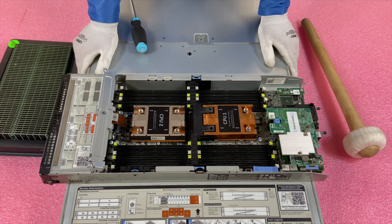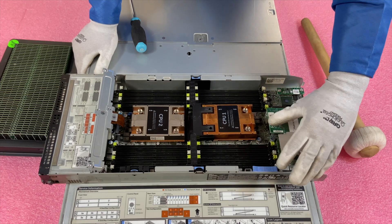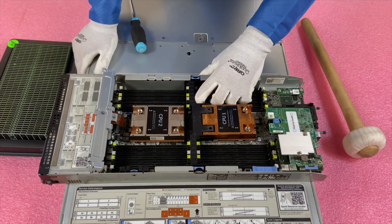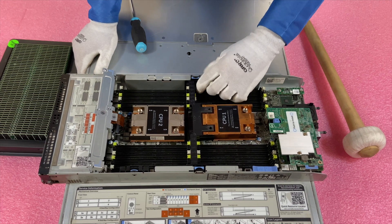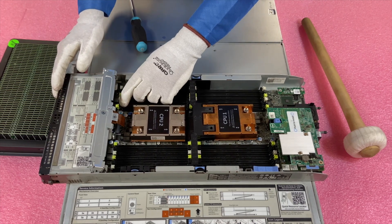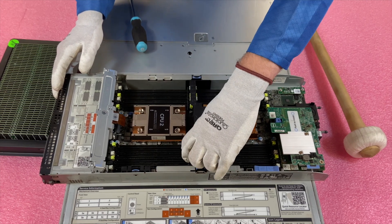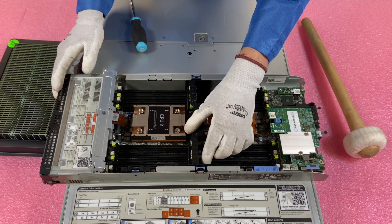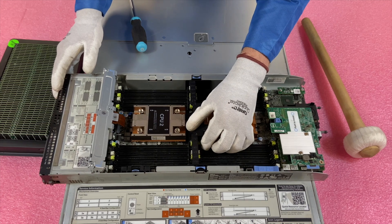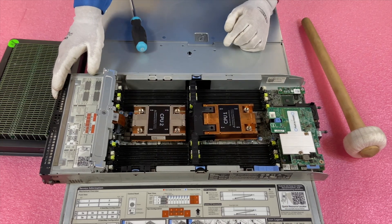Now let's get rolling. I'm going to start installing these and I want to show you a couple of tips first. I personally like to go through and pop open all my tabs before inserting. It's not something you have to do, but I like to do it because when I get the parts in my hand I don't want the tabs fighting me and potentially preventing the DIMM from going in. I could accidentally drop it, break a capacitor, or damage a DIMM — all sorts of things could happen by being careless. So I like to take a few extra seconds to make sure we're thinking about safety.